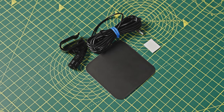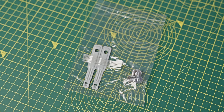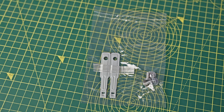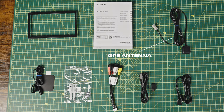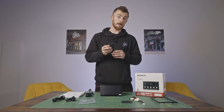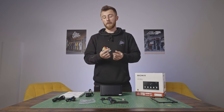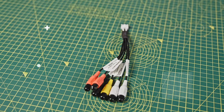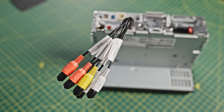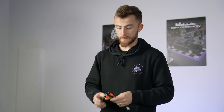The Bluetooth mic is plugged into the back of the unit and then routed up to your headliner. They also give you a flat plate mount so you can stick it onto a flat surface. Next you have a bag of accessories with screws and the removal keys for the cage that comes with the stereo. You also have your GPS antenna — this is a must-fit item as, being wireless CarPlay, the GPS is needed for that to work. You get the GPS itself and a magnetic plate for mounting it to a metal surface. Next you have your pre-out plug, which gives you all the inputs and outputs for accessories such as your front, rear, and sub pre-outs — these are 5-volt — as well as a camera input.